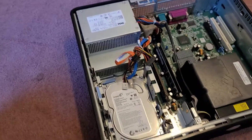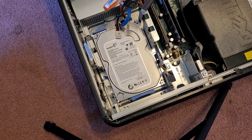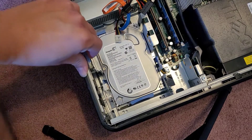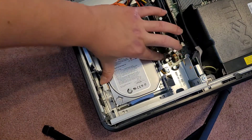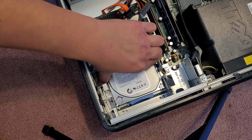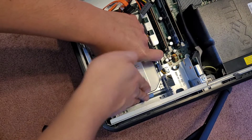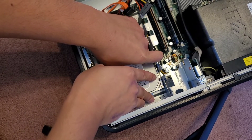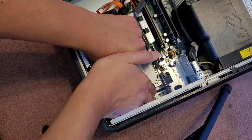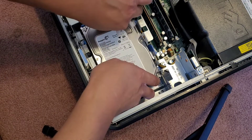Now for the hard drive — this one was a bit tricky. There are these two blue latches that get caught over here, so they're somewhat spring-loaded, so you've got to kind of pinch them both together, and then you can get your hand in here and push this. It's really hard to move for some reason, so you've got to just push it really hard. And there you can see, now it's loose. We can lift this up.